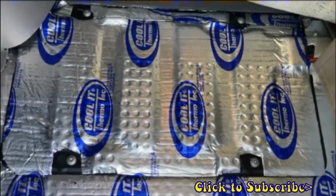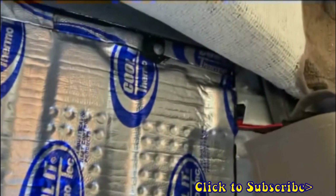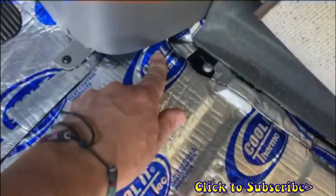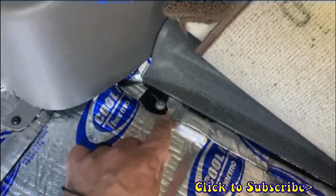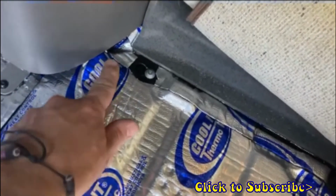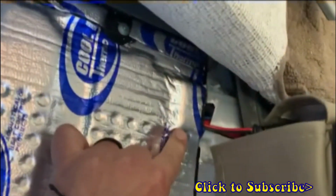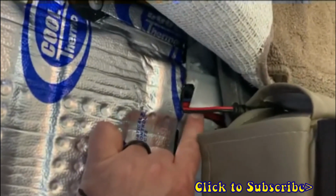Okay, so we have the battery cover back on. And just to make note, if you have a motorhome, you might have extra wires here. We had quite a few extra in here, and some that ran up this way. So I did not tighten these down real tight. I left this up a little bit because I was concerned with pinching the wires that went up here, because this little bump out is not really big enough for all of them that the factory has running up there. Same way back here, you can see the factory had cut away this plastic piece even to make some room.